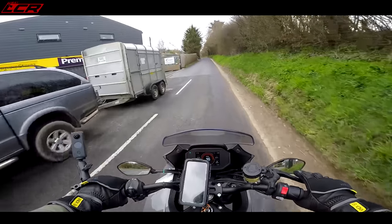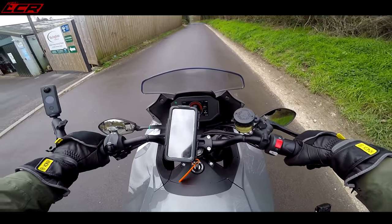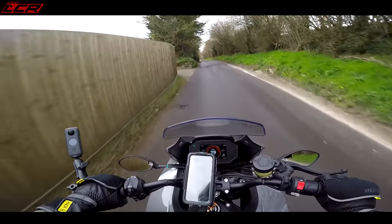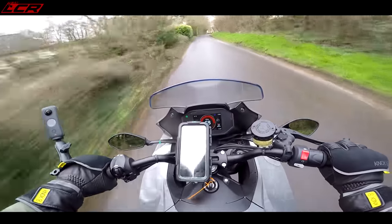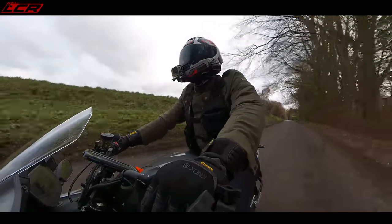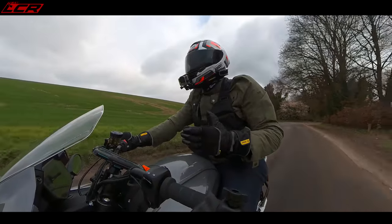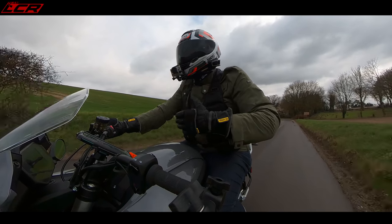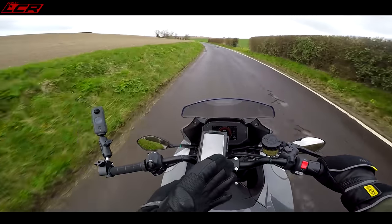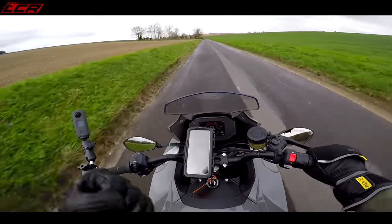I gave it a full bit of welly. What happens is the liquid in the lithium-ion battery becomes lazy when it's cold and can't transmit the electricity through it as well. That also affects the regen — when you're regening, it can't regen into the battery as efficiently either. So you've got a double whammy.